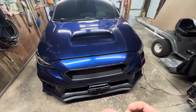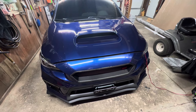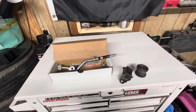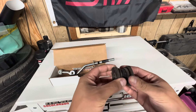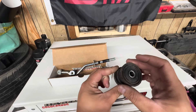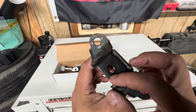It came with the rear bushings and front bushings, which I think are probably the same polyurethane material, though I could be wrong because the front bushings felt a little bit softer. Other than that, specs seem pretty similar to the Carboy kit — and the price is a little less. This here is the OEM front bushing, which is rubber. The rear bushing is kind of getting brittle.